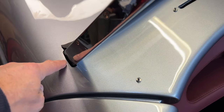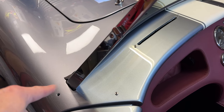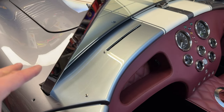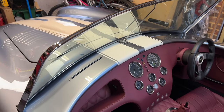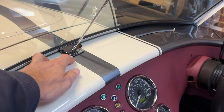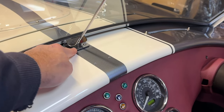Unfortunately they filled the holes I drilled for the escutcheons, which is a bit of a bind. We need to take the windscreen off, put the escutcheons on, put the windscreen back on, mark where they go, windscreen back out, drill holes, fit escutcheons, windscreen back in - about 20 times more often than I want. We also need to be careful with these M4 bolts and center those as the windscreen drops in, then do them up with a cut-off allen key.